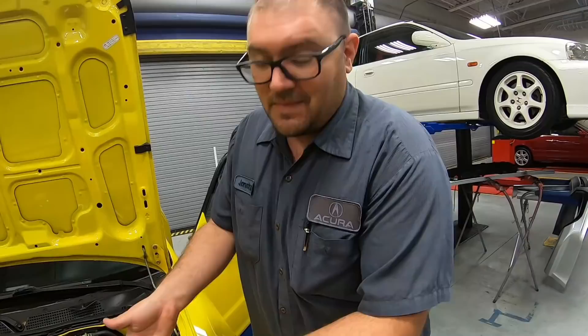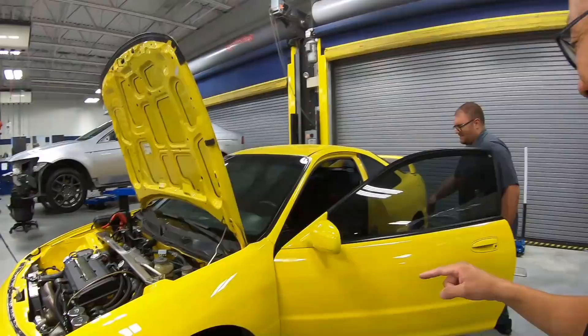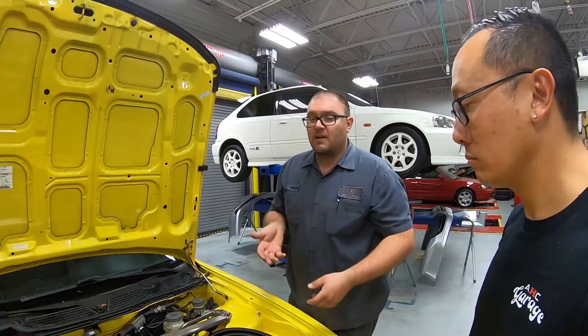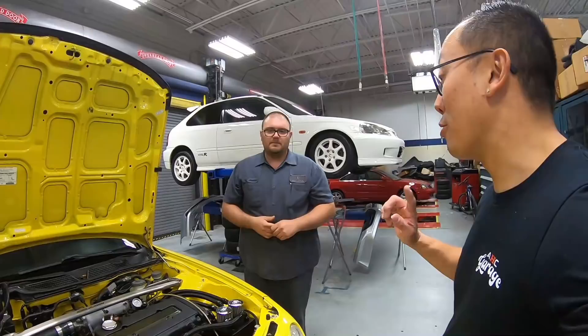Initially the customer thought it was the alternator, so I removed the belt and the noise is still there. Now we've got to get into the heavy internals. So we wanted to isolate it since he was thinking it was maybe the alternator — I isolate it by removing the belt. The noise is still there, so we really only have one other rotating bearing in here and it's the timing belt tensioner. I'm about 95% sure that's what the problem is. We have to remove the belt off the alternator, then remove the pulley, then remove the lower cover to get access to the timing belt tensioner.